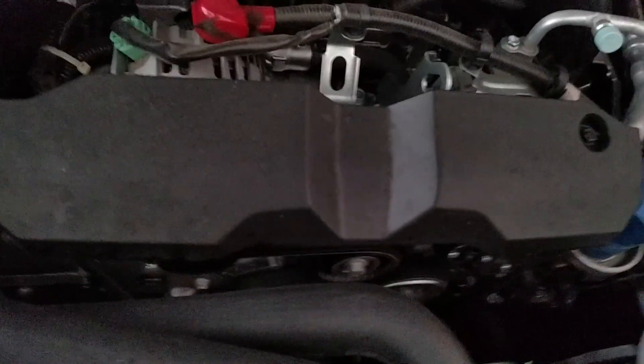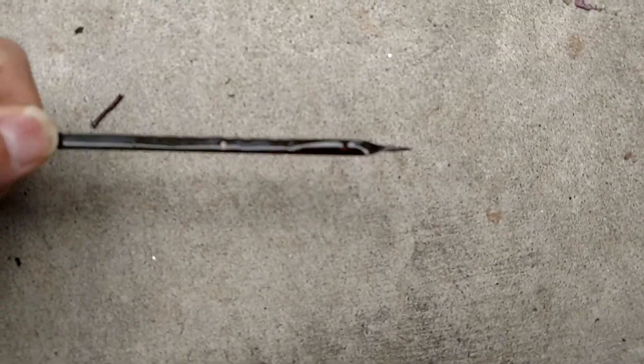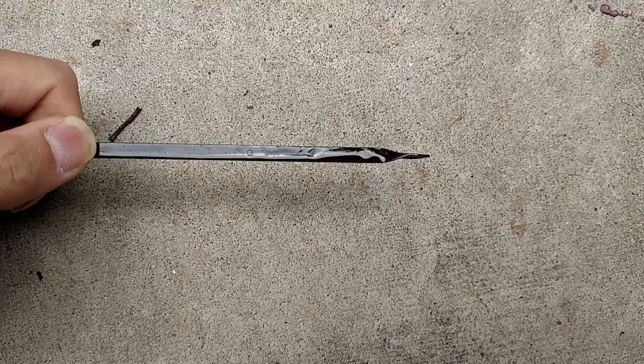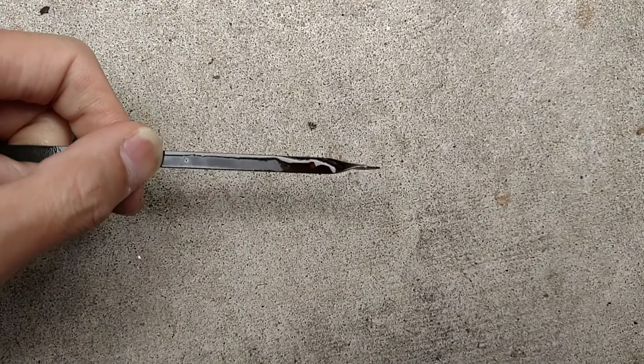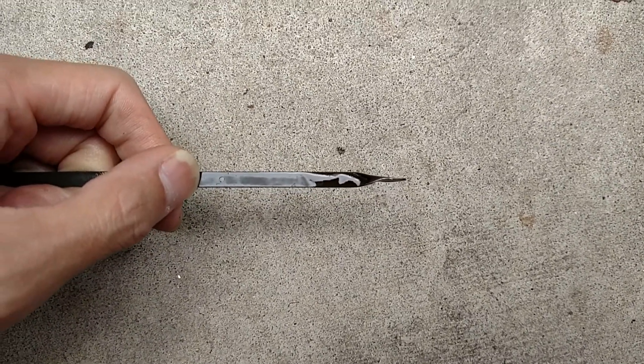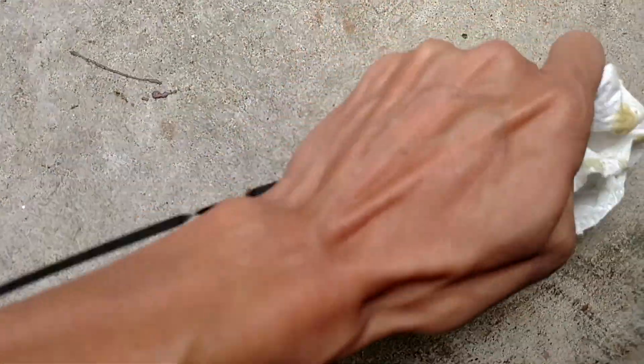Just to verify this again — put this in, and take this over here so you guys can see exactly where the oil is on the dipstick. There's the top side and there's the bottom side. It's definitely about 3 fourths of the way down, so it's about 3 fourths of a quart low, based on what I was instructed by Subaru technicians.